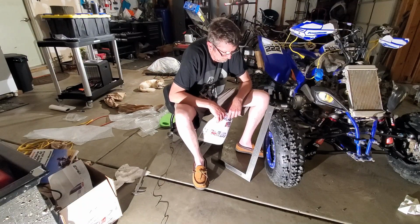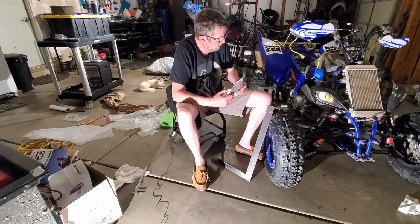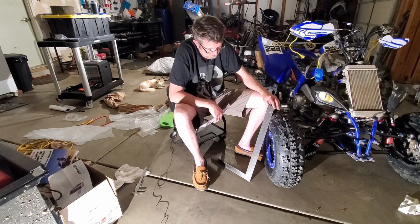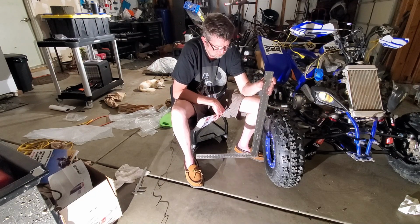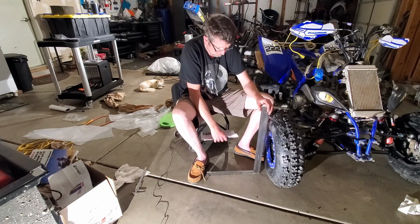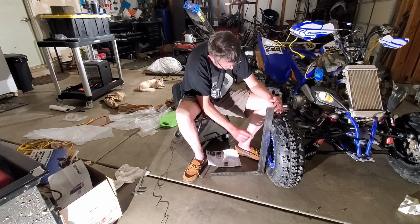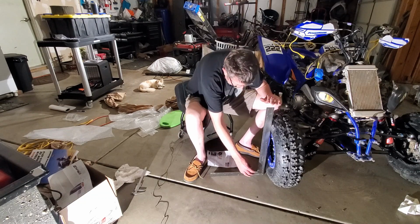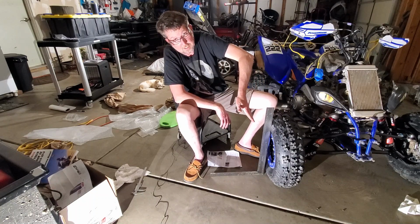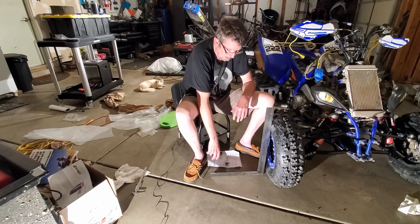All right, folks, so we're going to adjust our camber right now. That's the tilt out and tilt in of the wheel. When it's tilted out like this, it's positive. Tilted in, it's negative. What you need on this is a square, and some level concrete. Basically, on the center of your wheel, best you can, slide it up against there. Right now I'm hitting against the top, and if you look at the bottom, I can almost get a finger in. That means the top of this thing is like this. That's a lot of positive camber. I'm actually looking for negative camber.